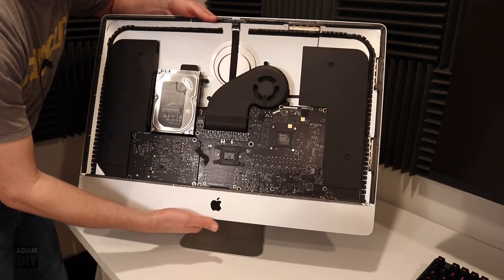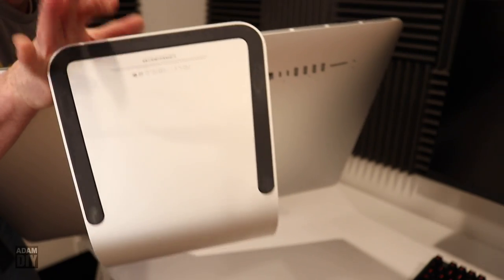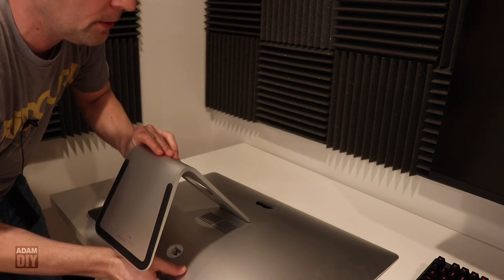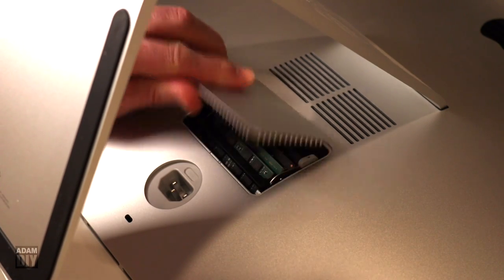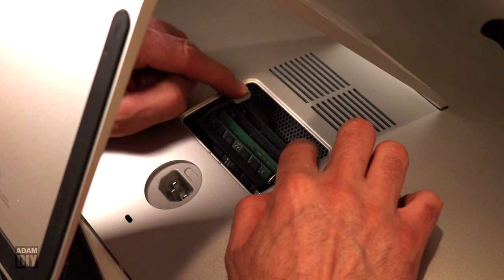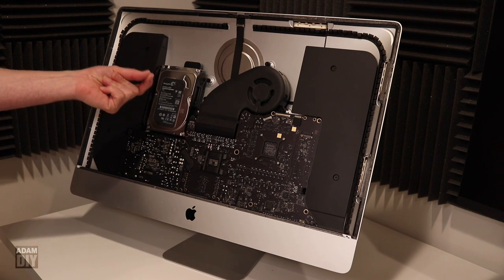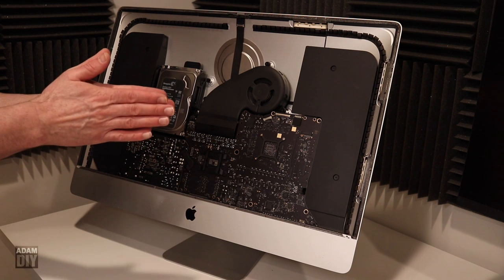Before we go any further, two quick things. Your model number is going to be right here in that writing. In case you need to double check that for some reason. And if you're doing a quick RAM swap, you don't do it through the glass — right down here on the back is the housing for the RAM. You push in there and you can access the clips; just push these back and you can pop them out. The older iMac had the glass held on by magnets, but this one is held on by double-sided foam tape, and the glass and the screen are combined into one.